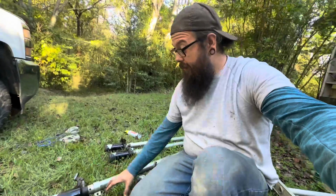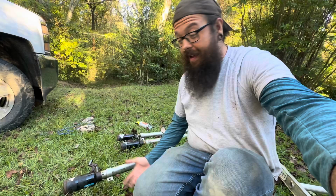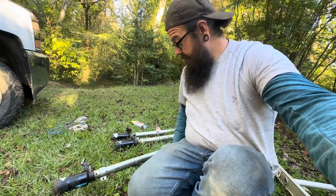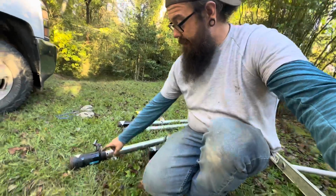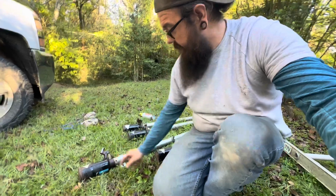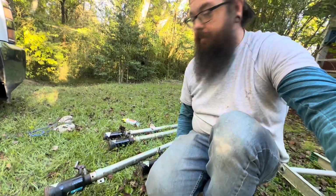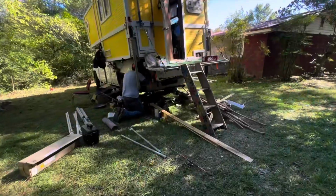This is a messy job because you have to disassemble them to replace all the fluid and the gaskets. So I'm doing it here, but now that I'm trying to disassemble them, they are seized together with rust on all of these components right here and this right here. And there's O-rings everywhere. So I'm gonna soak them in PB Blaster over there overnight and hope that it works. We'll see you tomorrow.